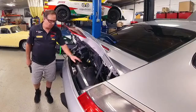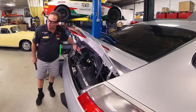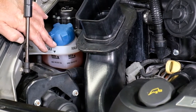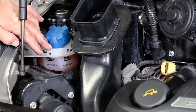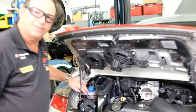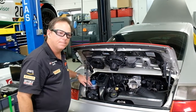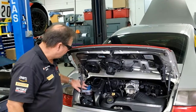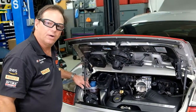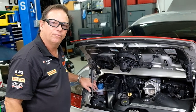Other items in the cooling system include the coolant expansion tank. Be very careful — there are aftermarket companies that make parts that don't live up to Porsche standards and will cause you issues. Use a genuine Porsche coolant reservoir, a genuine Porsche reservoir cap, and change your coolant often. I would recommend completely replacing your coolant every two to three years. It's not that difficult to perform a coolant fluid flush.